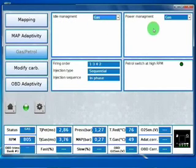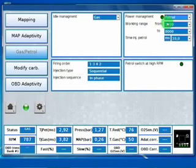Yeah, we have the same management on power. So here we have two kinds of selection. We have a simple petrol selection, where we can set the working range that we want. We will leave this for this example. But we also have the injection time that is needed for switching on petrol. For example, on idle, I can get over 2000 RPM, but I will not switch to petrol. As you see, the LED is still off, and here we are on gas, because we can choose the amount of petrol injection time that we need to switch on petrol.